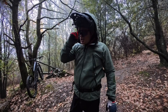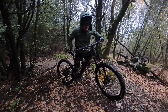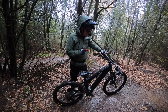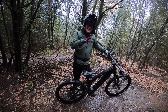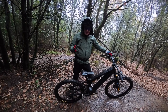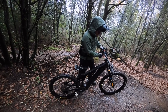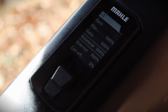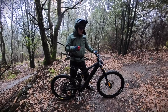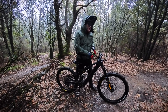And here we are at the technical section. I'm going to show you the difference of the software tune and how to tune the software on this bike. One of the things I think is fantastic about this system is you don't need an app if you don't want to use one — let's call it a data safe bike. It doesn't know where you live. You press the two power buttons together. The first tune we're going to do is where everything's at 100%, with a peak power at 600 watts. You press the two power buttons on the remote and it drops you into the menu.